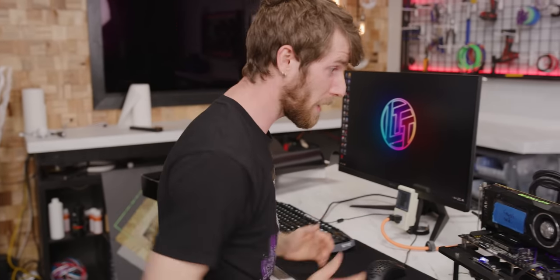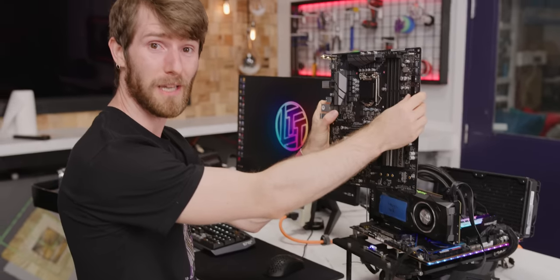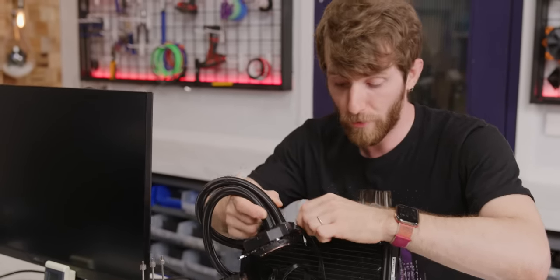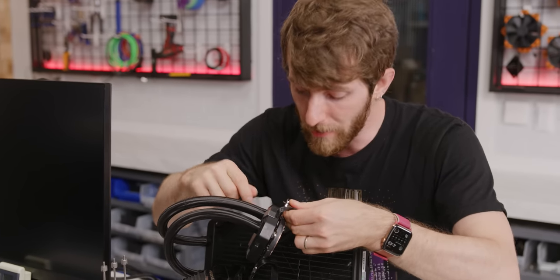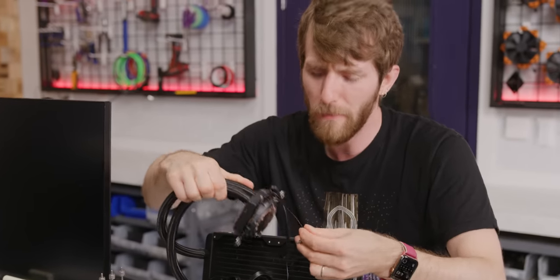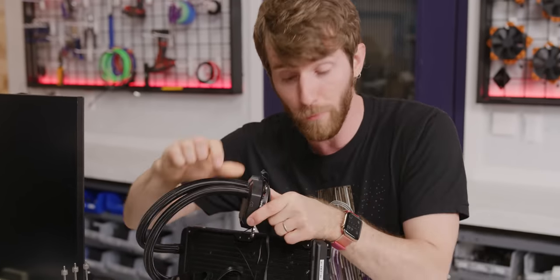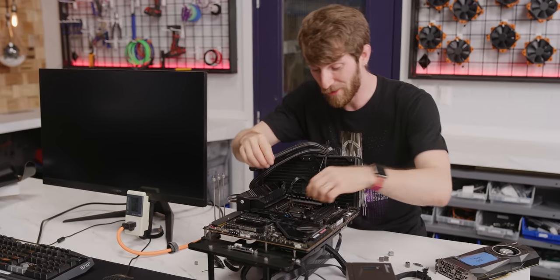Let's swap out the power supply and motherboard with our new ATX 12VO setup and see how it goes — I actually have not tried this. Now I may have put myself at a bit of a disadvantage here, because the lower you go in terms of power consumption, the less efficient a conventional power supply is. So the fact that I even have a discrete graphics card in here means that we might not see as extreme an improvement as we would if we were running onboard graphics. Things like RGB lights on the memory are also going to contribute to that.